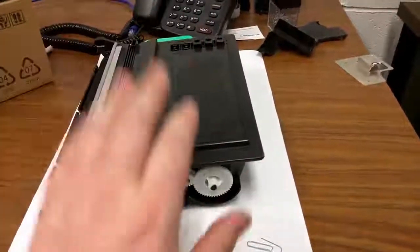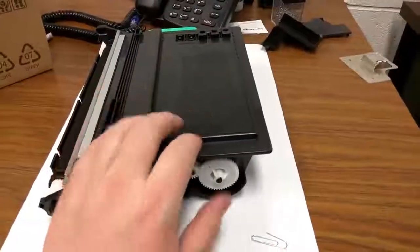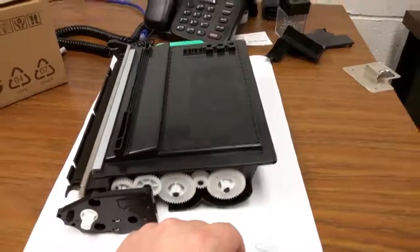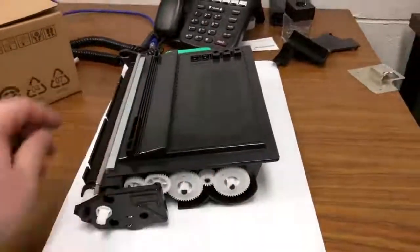You want to close the door, put the toner in — it'll look at a little spinny wheel thing. You're good. Open the door, take the toner out. If you do it too long, it'll throw an error code at you and then no one's happy, because they're like hey, you're breaking the machine.